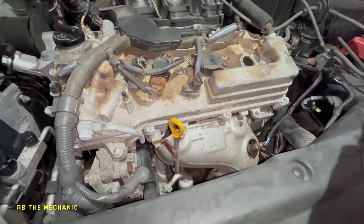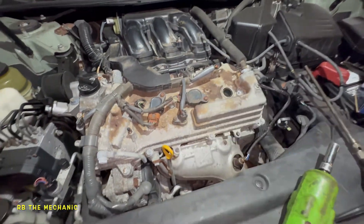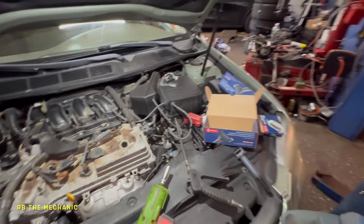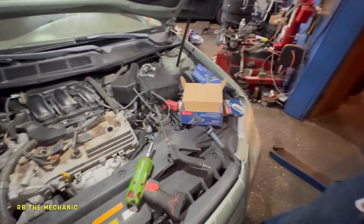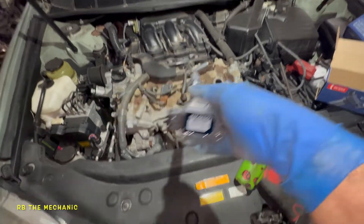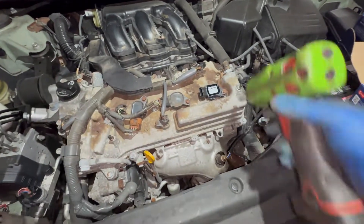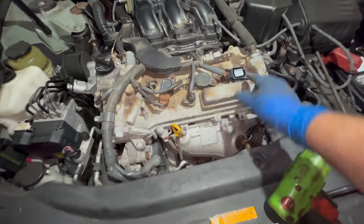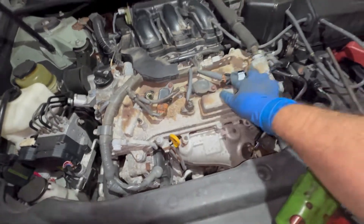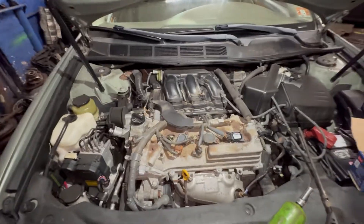The cylinder order is: 1 is there, 2 here, 3, 4, 5, 6 — that's the order. We've got the new coil out of the package. You simply take it, put it in place, and push down on it. If your ignition coil or spark plug has oil on it, you'll need to replace the valve cover gasket. Lock it up, close it, and if you want, add a little dab of silicone. Put the cover on, reset the light, and go for a spin. The light shouldn't come back on and you shouldn't have a vibration. Thanks for watching.